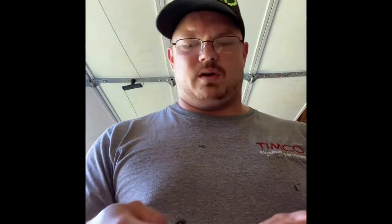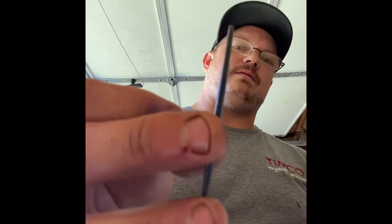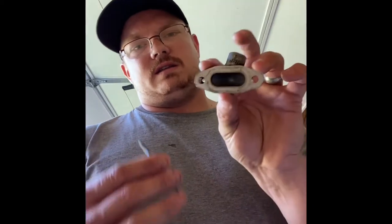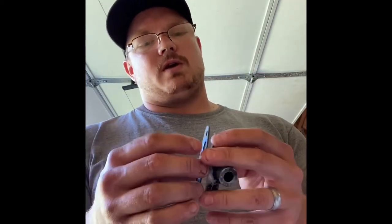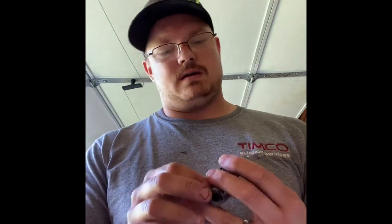All right, so I've come to the conclusion I don't think I'm going to reuse this little keeper. It seems like it's going to do more harm than good, because with this new one, you're not going to be able to see it with that thing out of focus. It's got 2 halves to it. It's got a rubberized half and then a gasket half, and the truck side only needs to seal around these holes. This needs to seal around this whole port, so I think the rubberized side will seal all the way around that port nicely, and then the other side will seal the truck side.